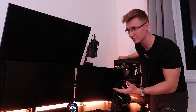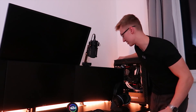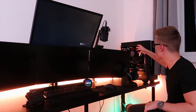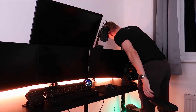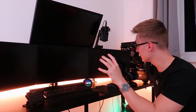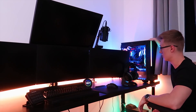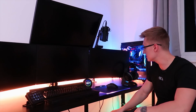Instead of plugging in an extra USB device, I'm going to try to plug in the three monitors into the back of the graphics card to see what happens. Monitors are plugged in, it boots up fine — the graphics card isn't at fault here. I've now plugged in my Stream Deck directly into the USB port on the back of my motherboard into a USB 2.0 port. No — how the hell is my Stream Deck causing this to power cycle? The Stream Deck has been plugged into the PCIe expansion card instead. I've now plugged in the cable for the Razer headset — the Razer headset is powered on and it did not cause the PC to power cycle.